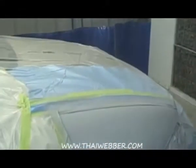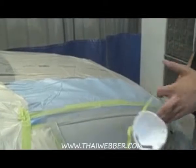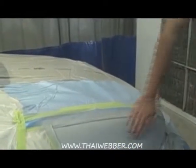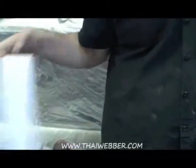We just epoxied this for adhesion purposes and corrosion protection, and then we put some primer surfacer on it to give us something to sand so we can get it ready for paint. So we're going to jump into this with some 320 grit on the blocks so we don't leave bad scratches. That way we'll hopefully won't have to reprime it.